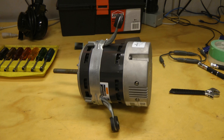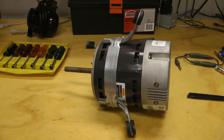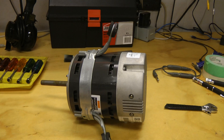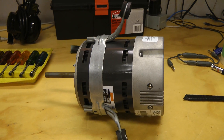That was easy enough to get out. The symptoms were: when the motor tried to spin up, it would spin slowly for a second or so, try to accelerate, and then give up. So I don't think the power stage is completely blown — I'm almost thinking it might be the coils, but we'll find out soon.